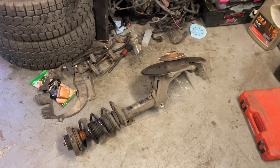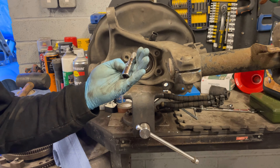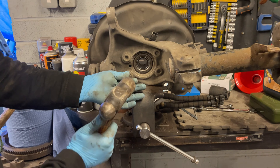In typical UK fashion it's just started to rain, so I'm going to try and get this off as quick as I can and get it into the vice. On the back side of the hub you can see those four spline bit bolts — they need to come out so we can knock the wheel bearing forward and put the new one in. These spline bolts are held in with an M12 spline bit, also known as a triple square. I'm going to give it a good smack because it's tight.